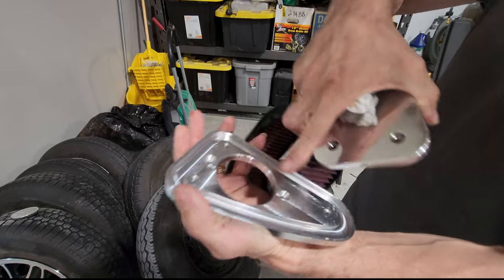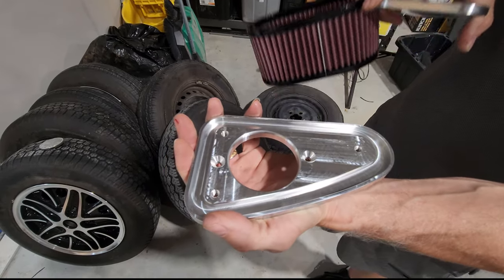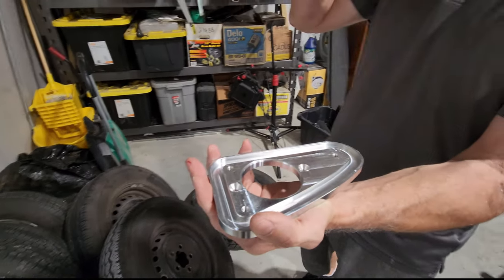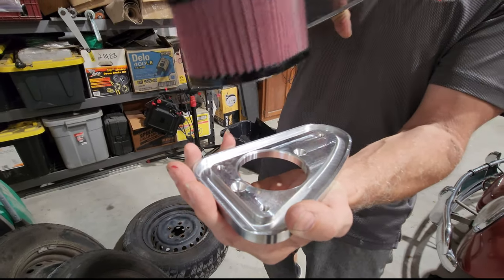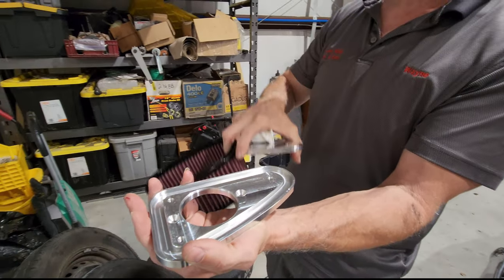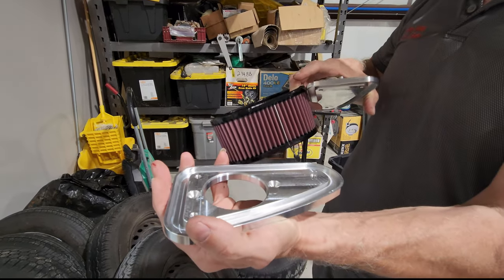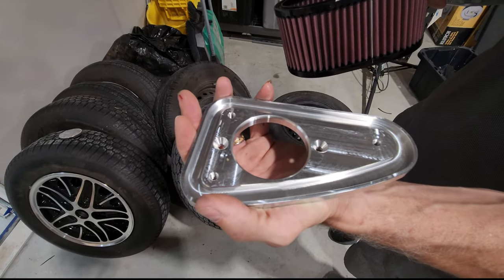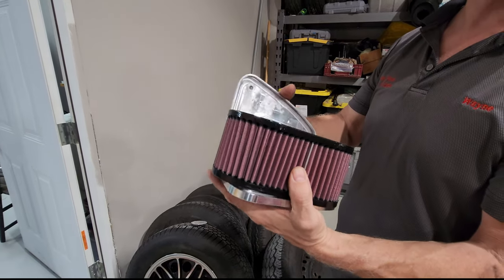This is where it's going to be bolted through the breastplate, and it'll bolt into a flange, not like yours. Yours already has a flange made onto it, and then you have to put a clamp on the backside. But this one, we'll weld the tubing onto the flange, and then we just bolt the flange up. That way, when you get ready to take the breastplate off, you just have to unbolt it. I have material on the way. I'm going to make probably about 20 sets of these.